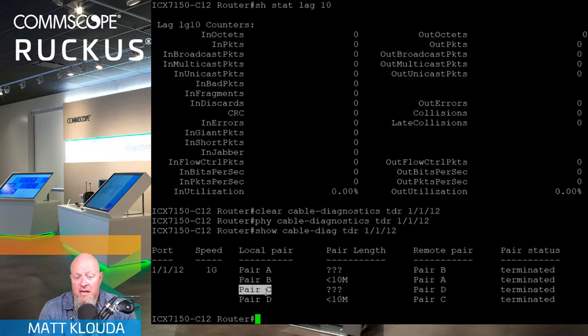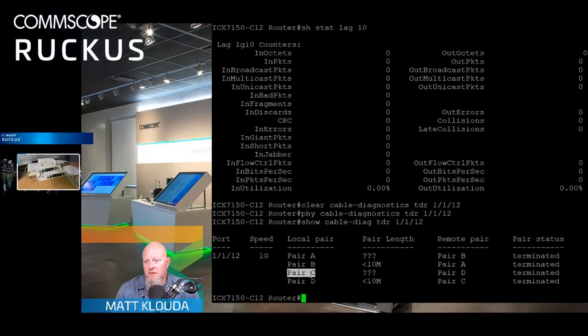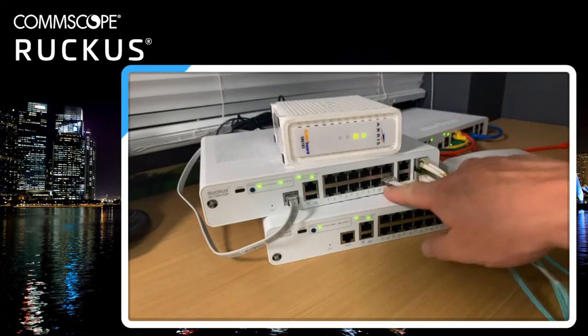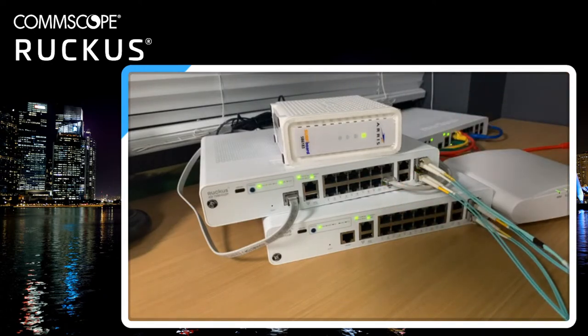So Andrew, I guess this is my question. How many physical ports or physical cables do you have plugged into your ICX right now? Because we know of three, right? We know of your cable modem, your access point, and your Ring doorbell. And do all three of them have a link light? And what I mean by link light is, do you see those green blinky lights on the port? Right there. Andrew, you know which port has it. Does it have a link light or no?